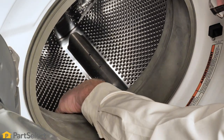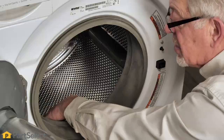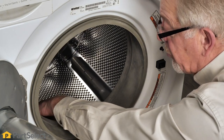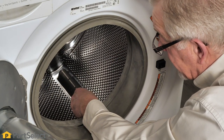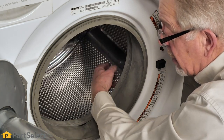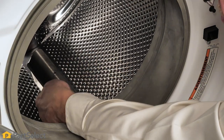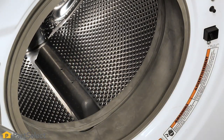We would first inspect those perforations, but it's not really a scraping sound that you would expect for something being dragged across the outer drum. In this case, it sounds like something may be inside of one of the drum baffles. Sometimes that gap at the bottom is large enough that perhaps a coin or a pin or something like that may have gotten into them.